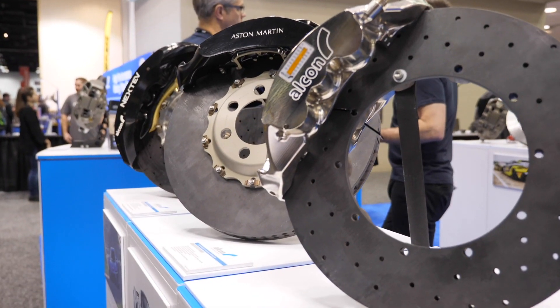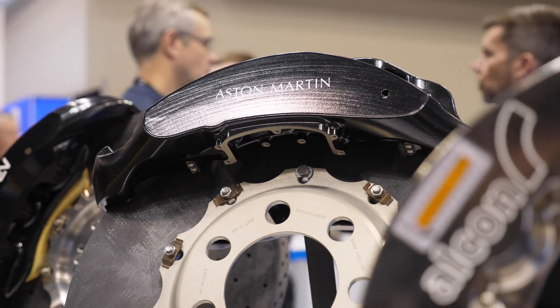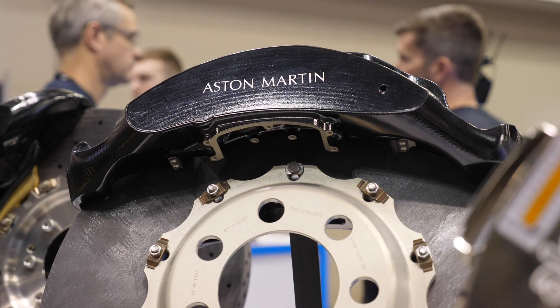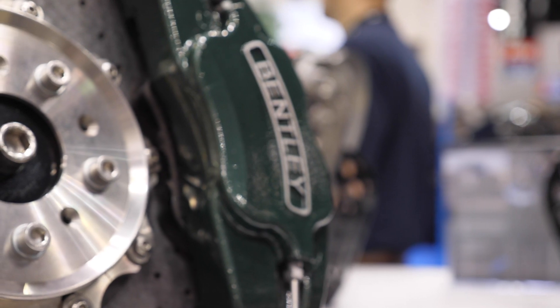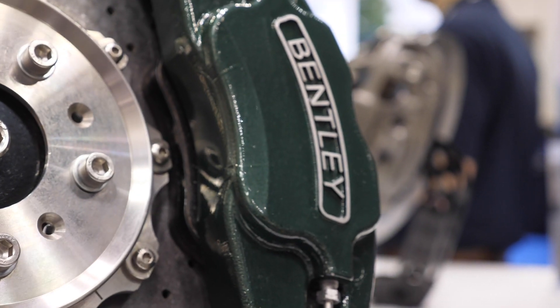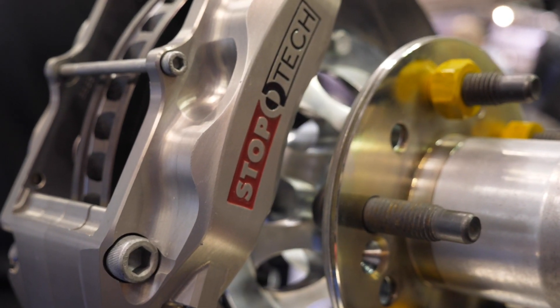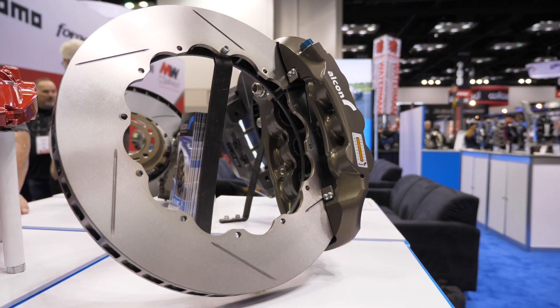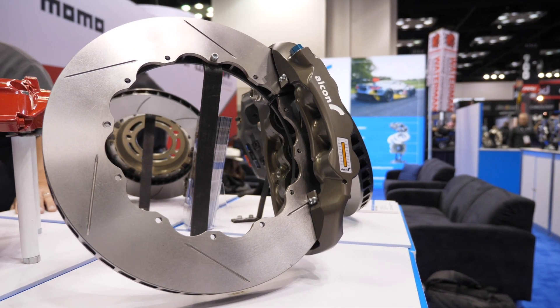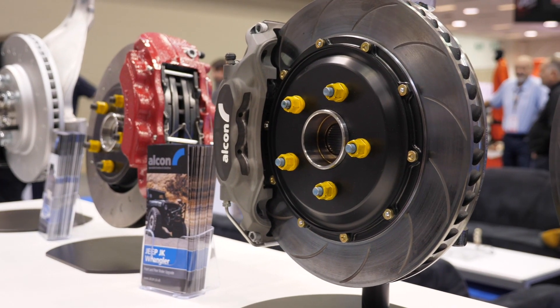The other aspect is of course the brake caliper itself. A lot of production cars have a slider style single piston caliper or dual piston calipers, and then we've got four, six, and eight piston calipers. Is it a case of more is better, bigger is better with a caliper? It's not quite that simple. One of the important things is the stiffness of the caliper — a sliding caliper isn't particularly stiff. All of the effort your foot is putting into the brake pedal needs to go into clamping that rotor. A larger pad area is also going to give you more wear resistance.